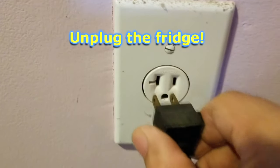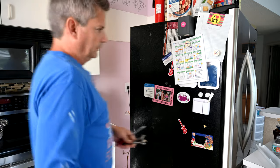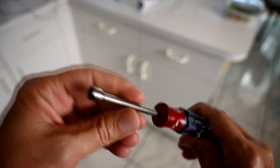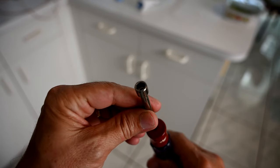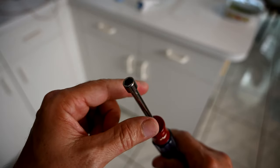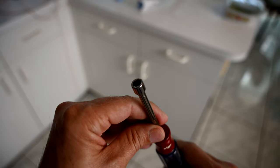Now we turn off the water supply under the sink that feeds the back of the refrigerator. You should never, ever start working on the water supply at the back of the refrigerator without turning off that water first. You'll need a flathead screwdriver, a half-inch wrench — though your size may vary — and a quarter-inch hex nut driver to loosen where the hose is strapped to the back chassis of the refrigerator with a C-clamp style clip.